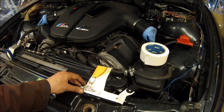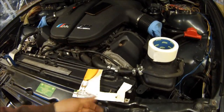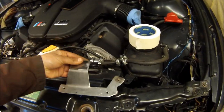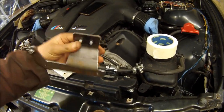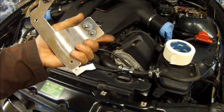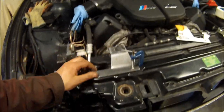Here's the card template for this side — it's the same one but with a bit extra for the coolant reservoir — and here's the bracket for this side. What I ended up doing was welding some studs: I just cut some bolts down, welded them from this side, and then I'll skim some body filler before I paint it. It just cleans the job up — no bolt heads, and when it's painted it'll all be a nice smooth finish.